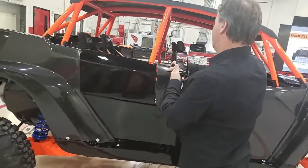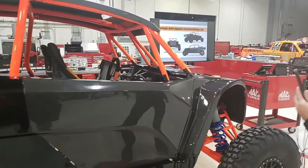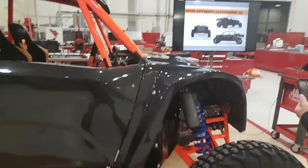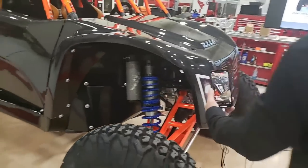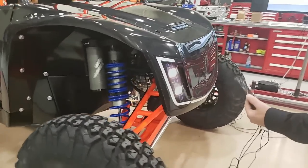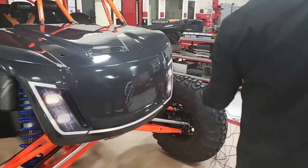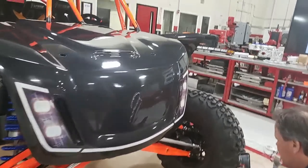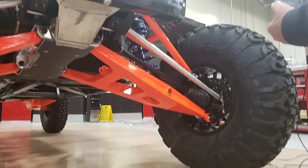DOM chassis, 4130 suspension, 4130 shock mounts. As I said, 4130 suspension. 6061 T6 front diff section, 7075 front tie rods. All production, so you don't have to go and get accessories. Forged spindle, production forged spindle. All shear, monoball rod ends.